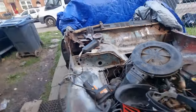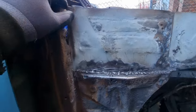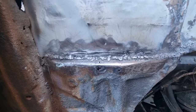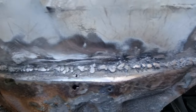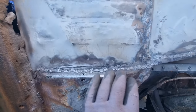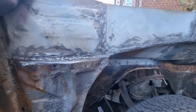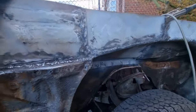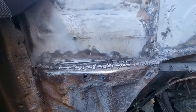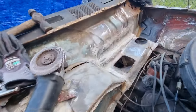I've been grinding all of this up and putting more thicker welds in. I've turned the welder up even more so I'm now getting some really big beads, and I will seam seal all of this. I've got some stone chip, so I'm going to clean all this up, stone chip it, and then move on to something else.